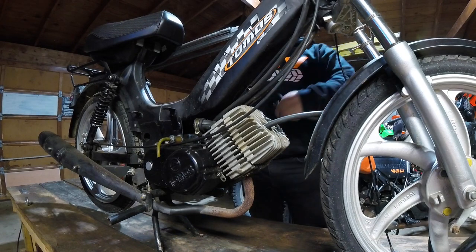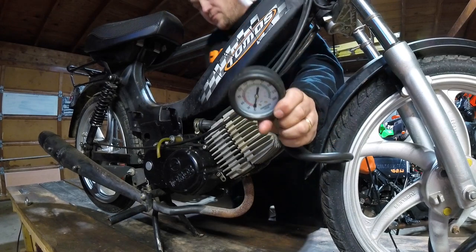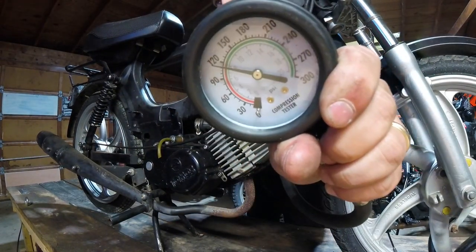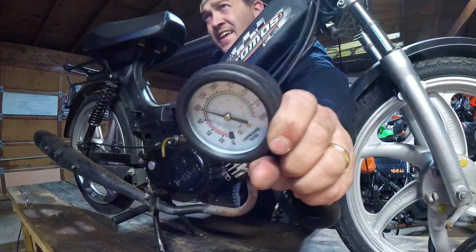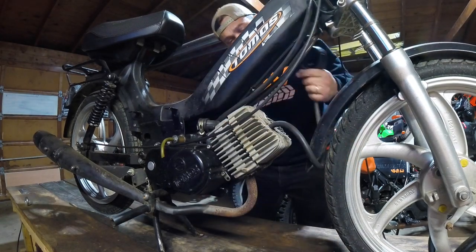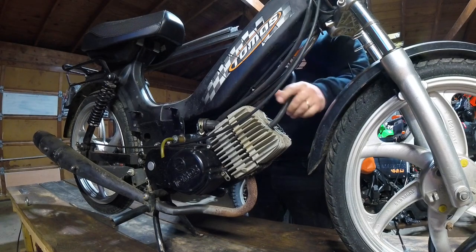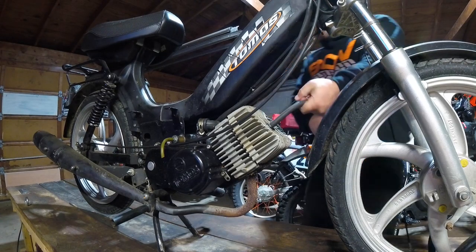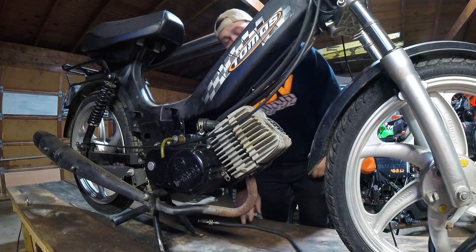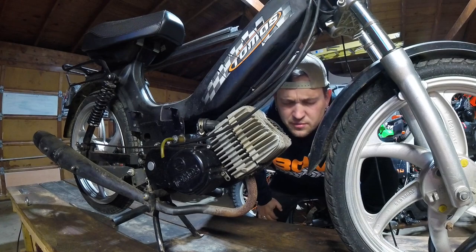Before we do anything, you'll see if this is worth our time. You're seeing this as I'm seeing it — no spare takes. Watch out while I give this a crack or two. Right at 120 — that is almost exactly where we want to be. These aren't very high compression or high performance, so 120 is overqualified. That means we've got a good cylinder and piston, which saves us. Compression — that's a huge one.